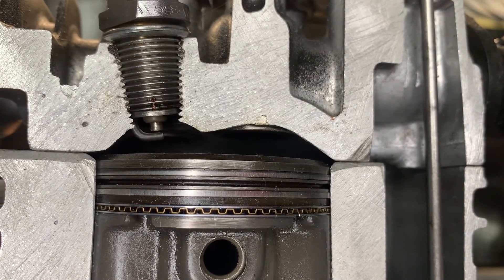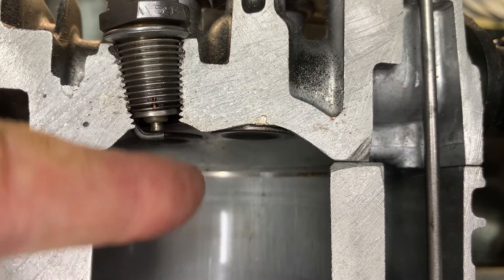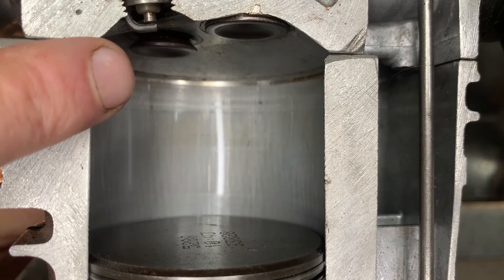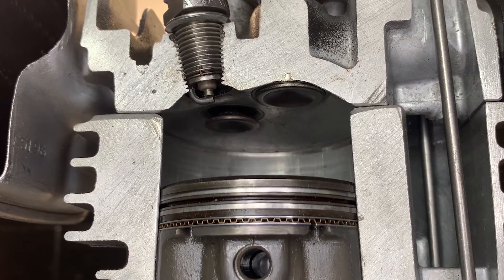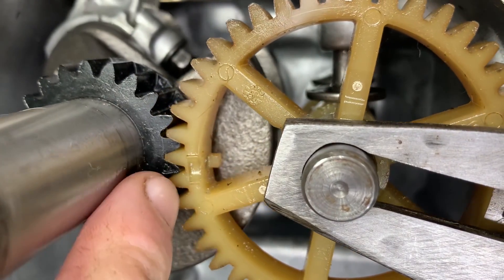Compression and combustion can now take place because there are no leaks in combustion pressure that would force the piston back down. Inside now will be the products of combustion — what we know as exhaust gases. As the piston approaches the exhaust stroke, the exhaust valve opens because the camshaft has rotated its high point on the second cam, pushing up its cam follower. At the same time the first cam follower is still at its low position, keeping the inlet valve closed. The high position of the second cam means its push rod has been activated upwards, pushing down on its valve and opening it, making way for the exhaust gases to exit as the piston rises. This is all made possible by the perfect positioning of the high and low points of the camshaft, provided it's timed up correctly between the two gears.